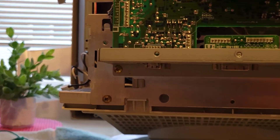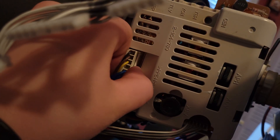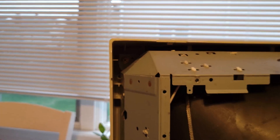This is the rest of the neck board I'm going to be taking off — just a couple more screws. Got these two little guys right under here, just want to remove those as well. It's super easy. Once you do that it's going to be able to come off. You'll be wiggling around. You've got to take this cable off — that's for the second input. And then we've got this ribbon cable to take out as well. Then you're going to want to take this 24-pin-looking connector off the yoke, and then these cables off the little control board that has your EEPROM and all that stuff that stores the OSD settings.